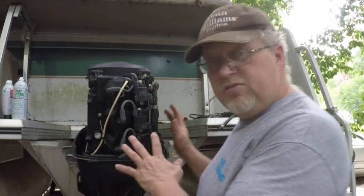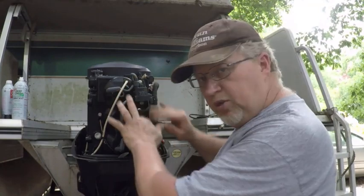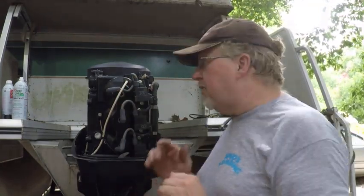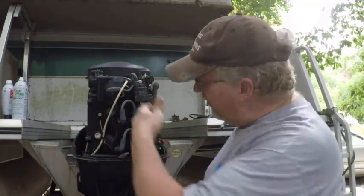As you can see, we got really lucky. This motor's internals are in great shape — beyond great for an engine that's been sitting for 16 years. I'm glad I took the time to lubricate those cylinders and make sure I didn't break any rings. It would have been a shame to tear up such a good motor. The next step is to go ahead and put the spark plugs back in, seal those chambers back up so we don't get any surface rust buildup.